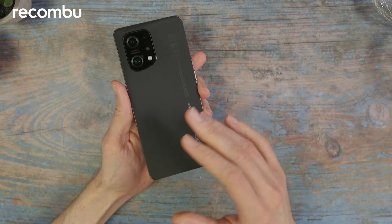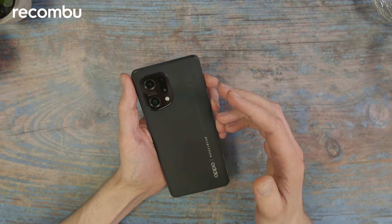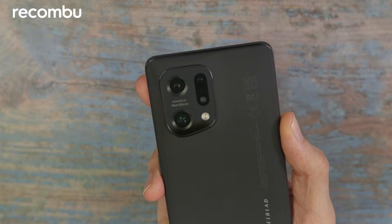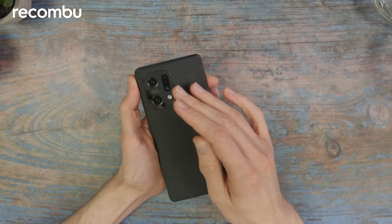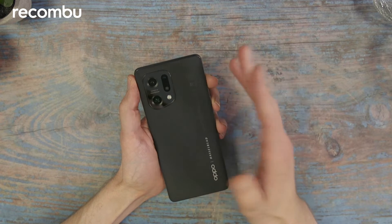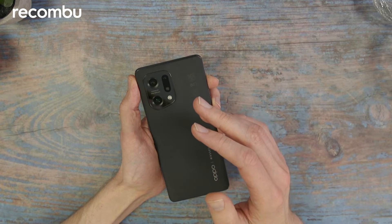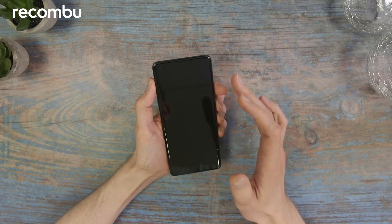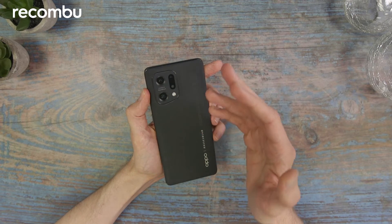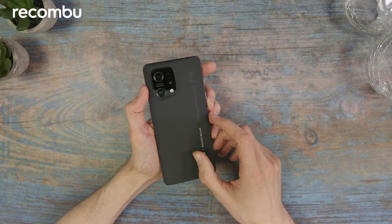You'll notice there's no headphone jack here, but there is NFC. And you can unlock the phone by your face or by a fingerprint. The camera module is strikingly similar to that of the Find X5 Pro — you've got the same physical setup. There's a Sony IMX766 main sensor with 50 megapixel resolution for the wide angle, and that same sensor is used in the ultra wide as well, which has a 110 degree field of view — so two 50 megapixel sensors. There's also a 13 megapixel telephoto sensor, a Samsung S5K3M5. On the front you've got a 32 megapixel selfie camera, though image quality could differ from the Find X5 Pro based on processing, since this one has a Snapdragon 888 chipset whereas the Pro has a Snapdragon 8 Gen 1.